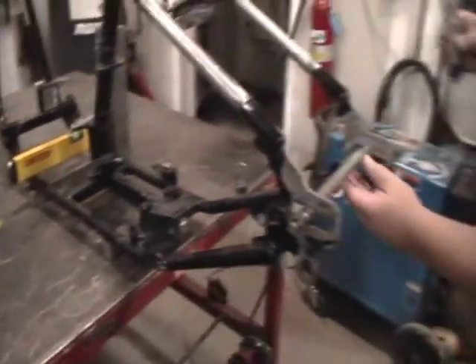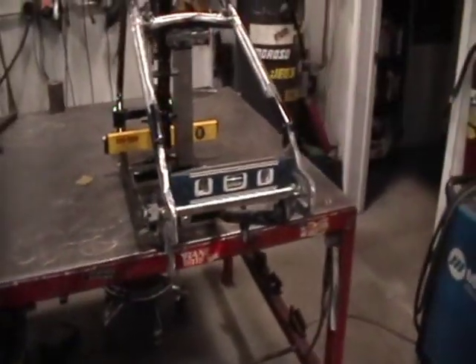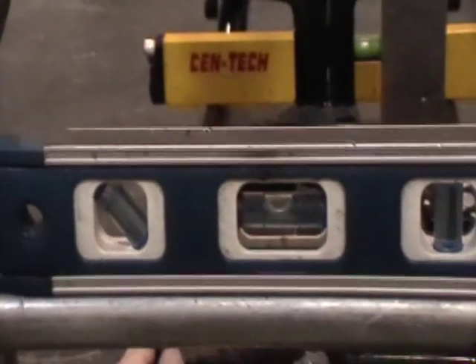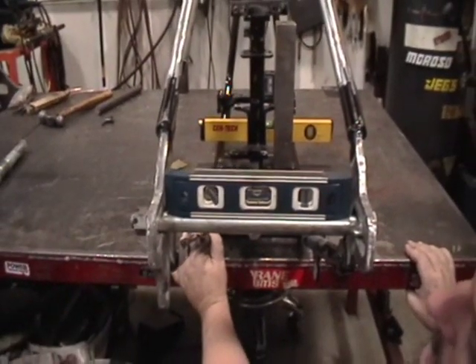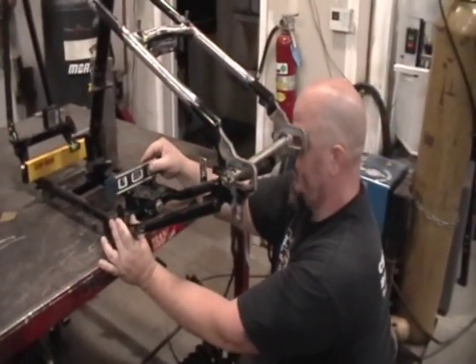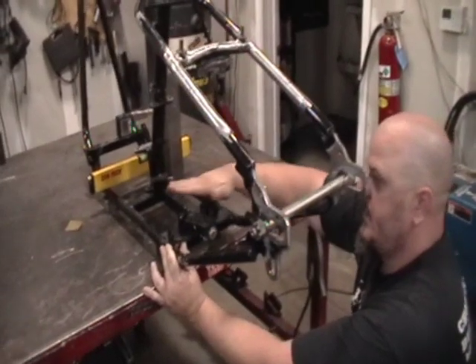Working on back — I just took an axle off the pile, it's a three-quarter axle. You want to get a close-up of that bubble there, Big T? Bubble left. With the front motor mount on zero, rocked back to where it's at zero, you can see that the axle is still bubble left. Rear trans is bubble left. Front trans is almost level but starting to get bubble left. So what we know is that as the frame comes back, it's starting to plane like this, and it's getting worse as it comes back.